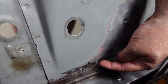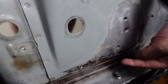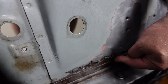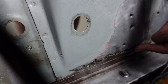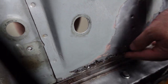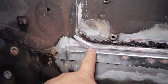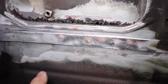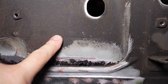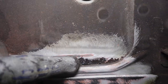So I'm just going to cut along that line and basically butt weld the strut tower into the existing bottom half of the strut tower and probably a little bit into the chassis rail. So it should be plenty strong. It may not be as neat, but at the end of the day we're going to have lines covering that up, so when I sand it smooth and then paint the bay, you won't notice it. From the inside you can see this is the wheel arch piece — it goes all the way along the bottom. You've got the chassis rail part and there's two parts there, and then this internal strut tower piece. But yeah, definitely a hole there. You can see right there — I can put the screwdriver all the way through. So let's get cutting.